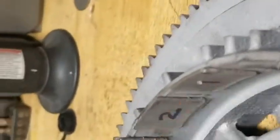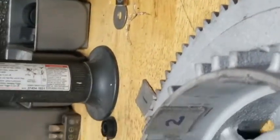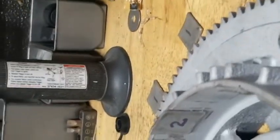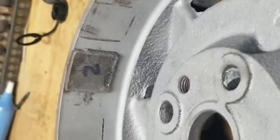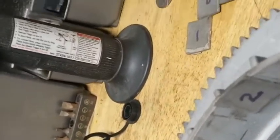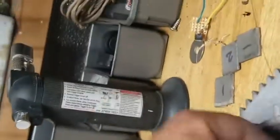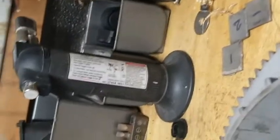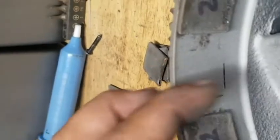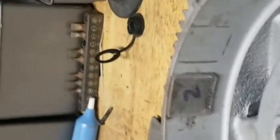I lifted all the ones that were loose — there were various places in the flywheel, some were right up against the coils. I just wanted to get them labeled so I know which is which. We're going to JB Weld these on. I sandblasted the whole thing since it was rusty anyway, and I'm going to coat it with an epoxy primer. I'll check them all to make sure none are loose. If they're glued in, leave them alone. You can see on this particular flywheel it left marks where the old ones were placed, so I don't have to measure it.